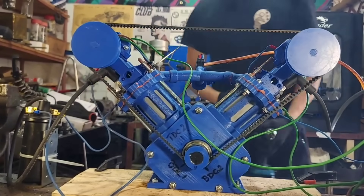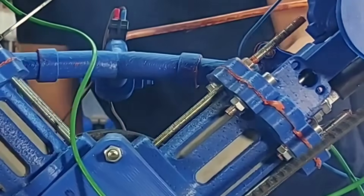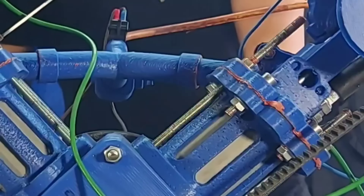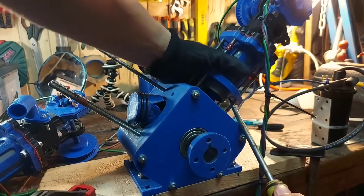That's a lot of smoke — but all of this smoke is actually a good sign. It tells us we have good fuel delivery and a good spark. The only thing left for this engine to start is compression. Re-watching the footage, I realized most of the smoke was coming from inside the crankcase, which means bad rings.